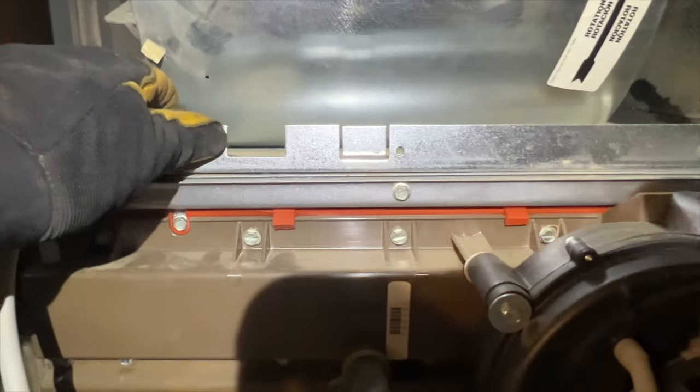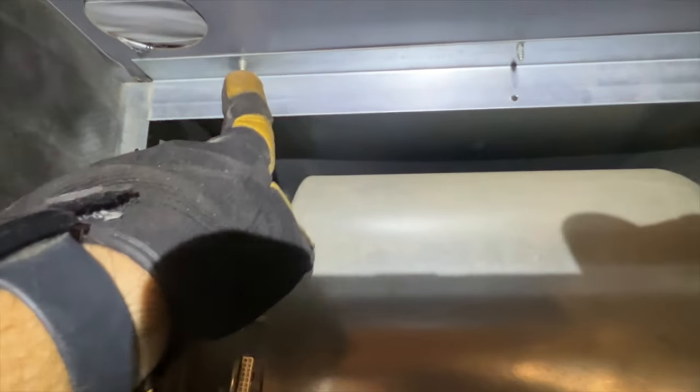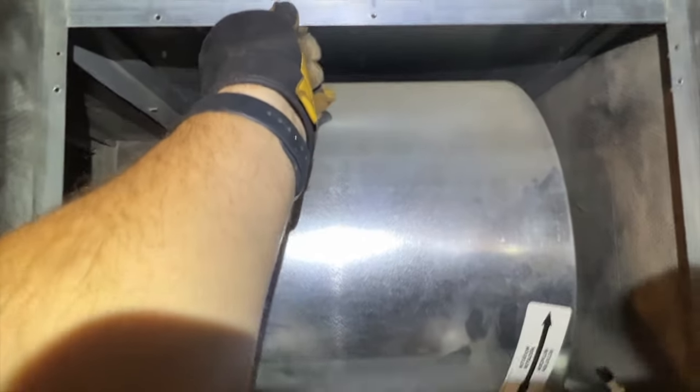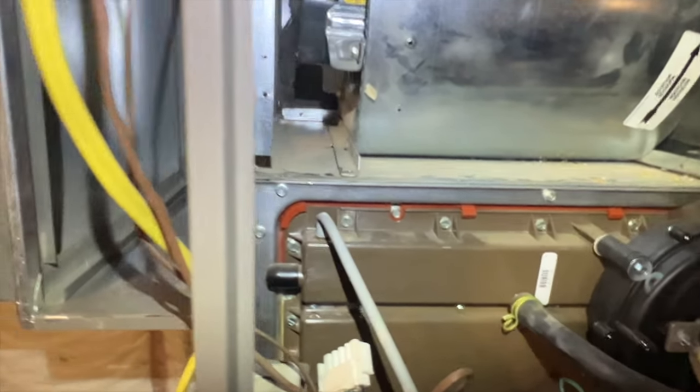You can see the blower housing is kind of over this bottom piece. Take out these two screws sticking out over the bottom piece — you're going to have to move it out because it is behind this piece, so I need two hands. Now this piece has got to come off: there are three 5/16 screws on top, probably covered in stuff. Get those out and it just pops right out. That bar with the three screws just drops down. Oh — and the wheel does spin freely.